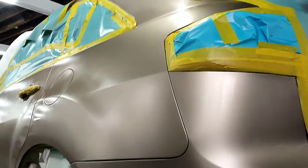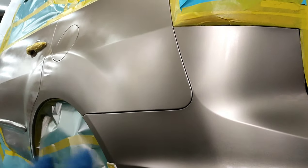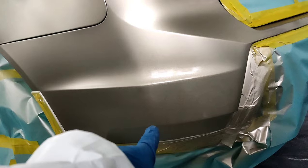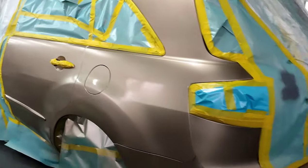Now, is this wet bed going to stay wet through the second coat? It might stay a little tacky. That's okay. We're going to get more color blender. We're going to mix our base 1-to-1 with the color blender and then blend and fade out our color even more. And this is all going to look good. Just wanted to show you guys that. I'll catch you guys on the second coat of base.